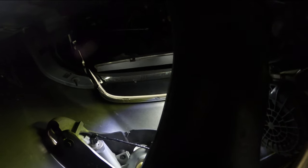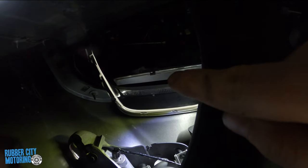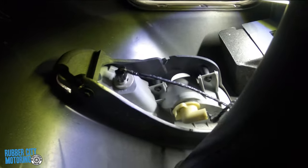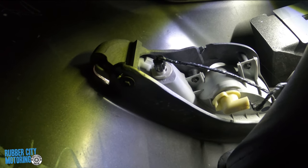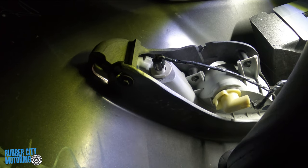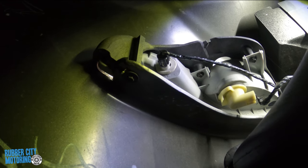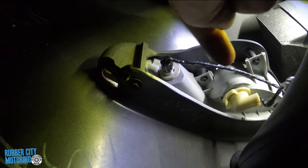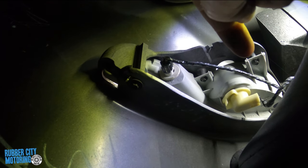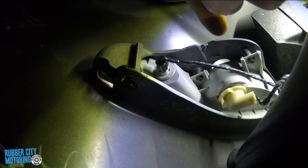I'm going to guide you up through here. That right there is our brake cooling duct. This is underneath after we've removed everything. And you can actually see up there — that's the bottom of the headlight. Now this is the driver's side, so point of reference, you're going to be looking at three bolts. This is the way I found it easiest to do it. Some people actually take the top headlight out to get to it, but I like this way the best — it seems to be the easiest. This bolt on the end, that one, and that one — those three allowed me to have access without removing the extra bolt on the inside that's tougher to get to.